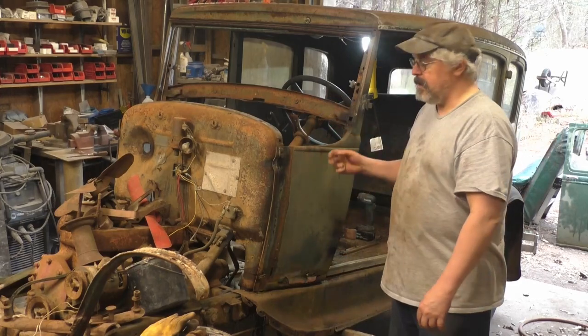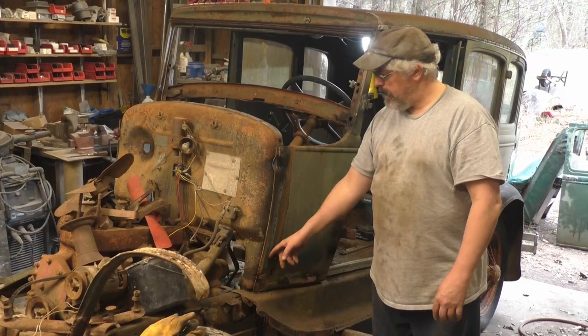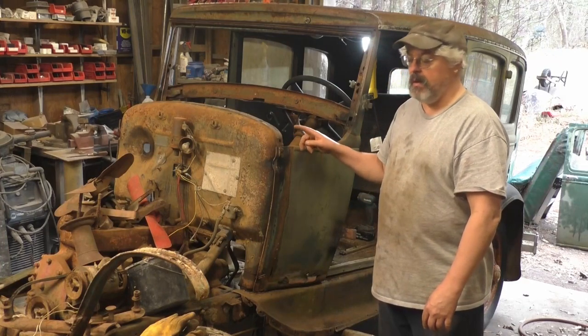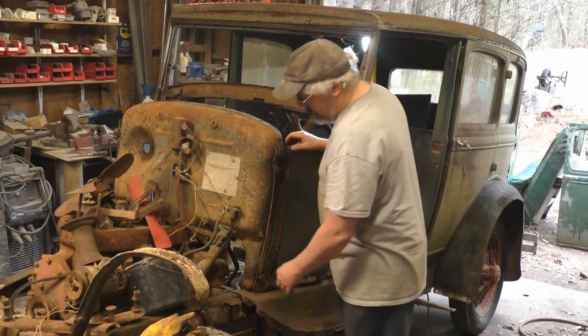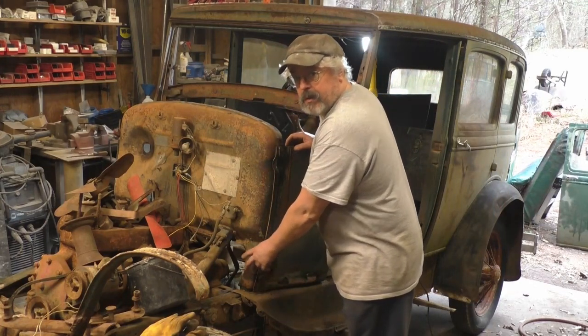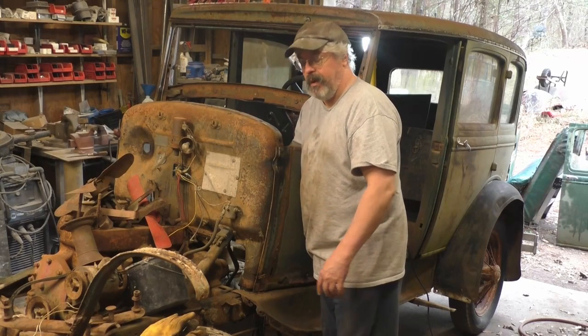I was aggravated. So I think next video I'm going to try to pull the firewall. I've got to find the spot welds on each side of the cowl panel here and grind those out. I know there's some welds and rivets down here at the bottom. I've got to figure out the inside where the feet brackets and the subrail are.